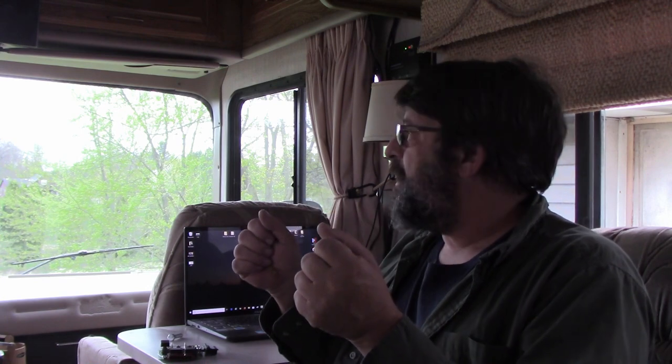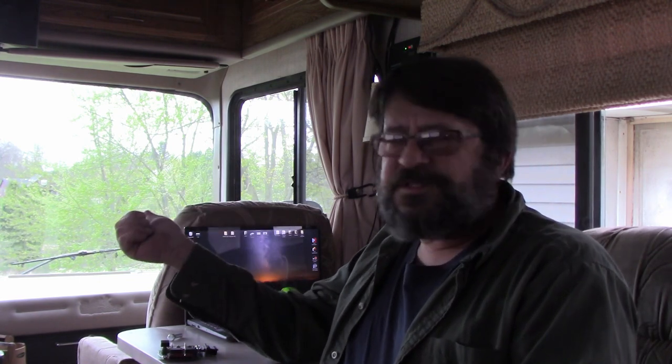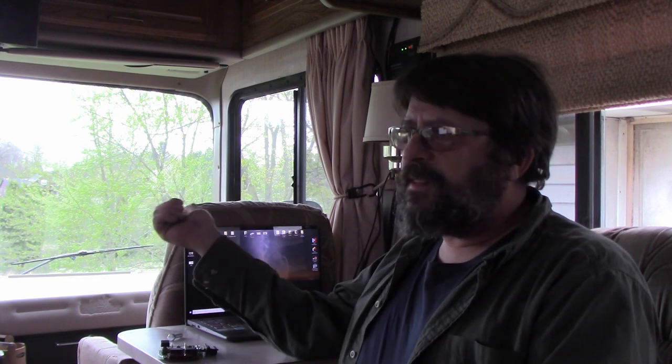Yeah, you get up to about 45, the front end would start kind of vibrating a little bit. Sometimes more than a little bit. It was annoying. And when I first got it, it actually did it worse. And we thought, well, maybe the front tires, the thing did sit for a long time. Thought maybe the front tires got bad spots on them for sitting in one place for so long. So I put 2 new front tires on it, and that did improve it a good bit. But the vibration never completely went away. But it did now. It's crazy.